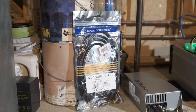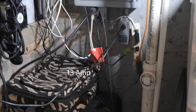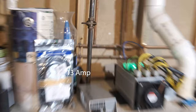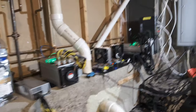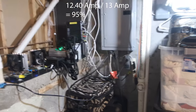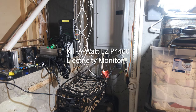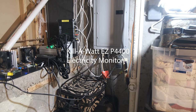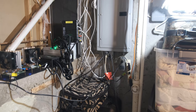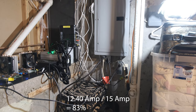I looked around and found that the cord plugged into my gaming rig was rated for 13 amps, and that's what it's running on right now. But that's really not great either — 12 and a half out of 13 amps is really close. If I touch that cord right where it's plugged into the kilowatt meter, it's kind of warm. So I've ordered some 15-amp capable power cords online and I'm going to switch those out.